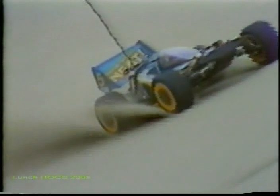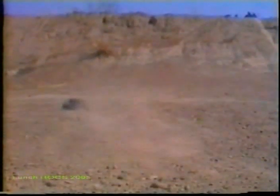The two-piece polycarbonate body consists of an upper body and an under-cowl skid plate in a teardrop design. This aerodynamically tested body shell not only cheats the wind, but also provides some protection from dirt and debris. Under this body is a two-part FRP chassis and frame, supported by a double wishbone suspension system all around. All suspension arms are connected by metal-to-metal ball links for the utmost in precision and smoothness, and the arms were designed not to extend down from the chassis bottom, allowing good ground clearance.